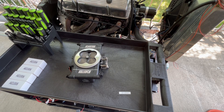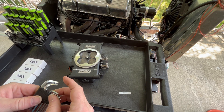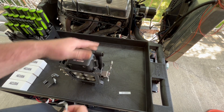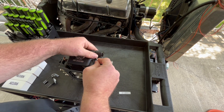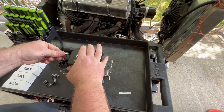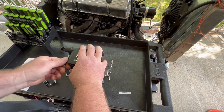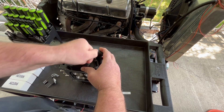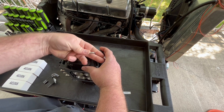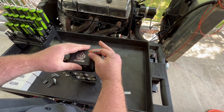Hello fellow enthusiasts or super nerds — we're starting a special project by popular demand about an E85 conversion. This is a motor test stand. It's probably a multi-part video. Essentially you've got to put bigger injectors in — it's already got 100 pound an hour injectors. I'm going to put in some 160s, make sure it runs on gas, then convert the fuel system and calibrations. Weirdly enough, if it runs good on the small block, I don't mind sharing the actual fuel table and calibration.